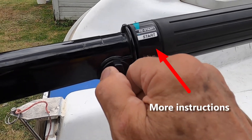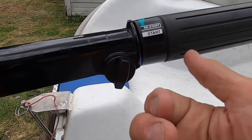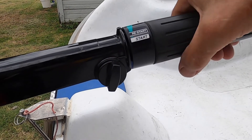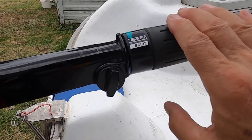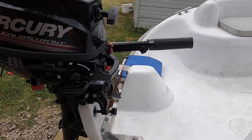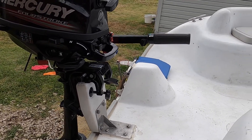Another thing to show you is the throttle lock. You tighten this down so the throttle will stay set where you put it. You can loosen it so it recoils back to its regular place, or tighten it so wherever you leave it, it stays set. This is great because with a motor like this you want to be able to turn it on, walk away from it, and have it stay pointing in the same direction and at the same throttle setting.